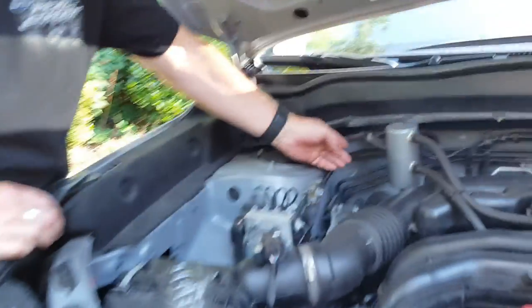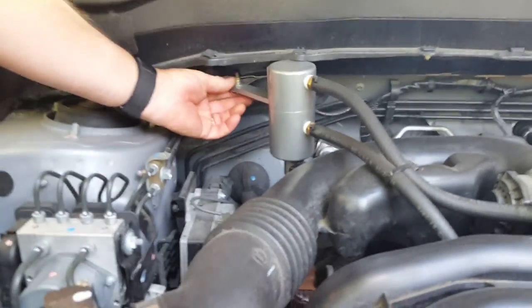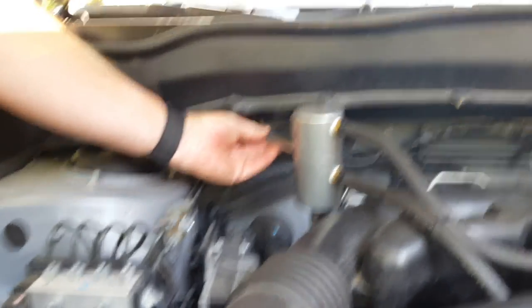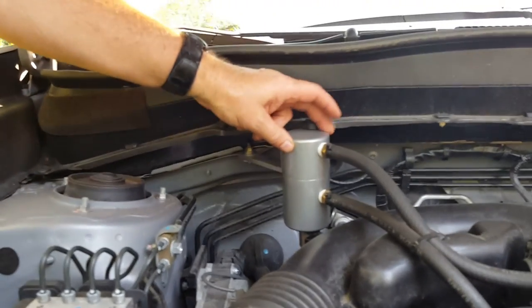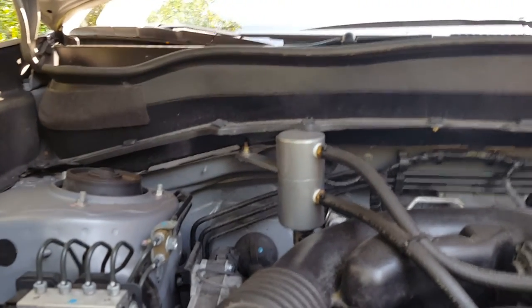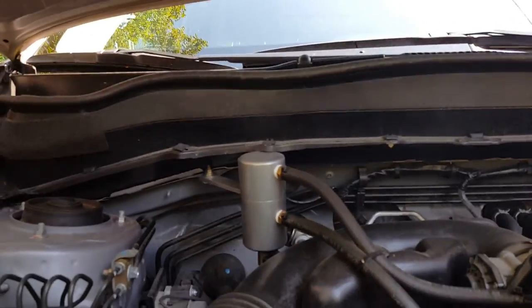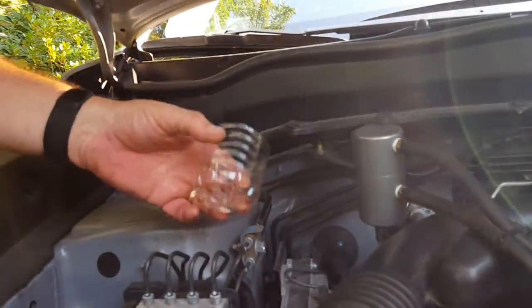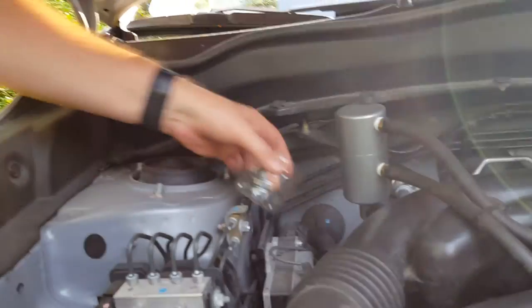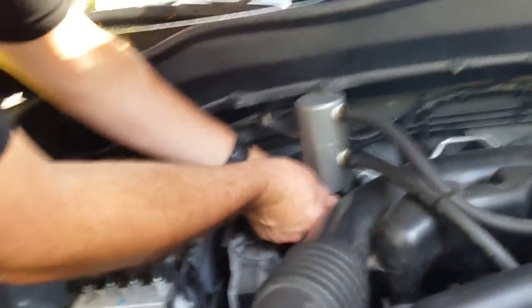On this car, I've mounted it here on this unused little fitting, and I tucked it up underneath — it's very stable and hasn't moved since I put it in. I generally check these about every two weeks, so right now I'm going to empty this one into a cutoff cup to see about how much oil it has collected in about two weeks of average, normal everyday driving.